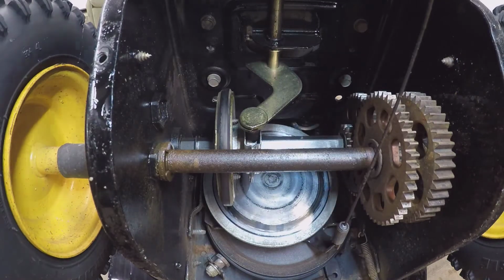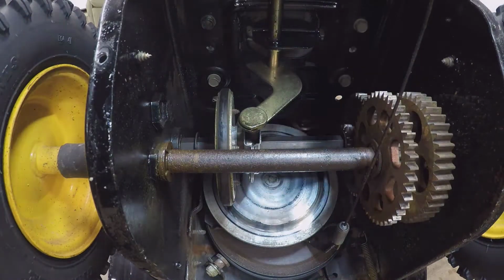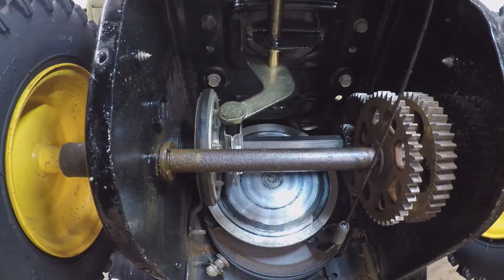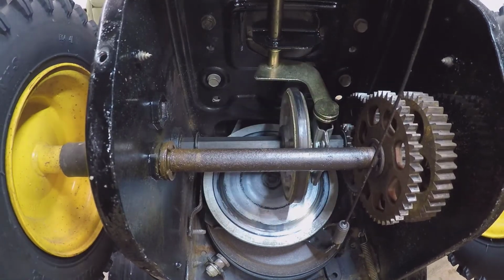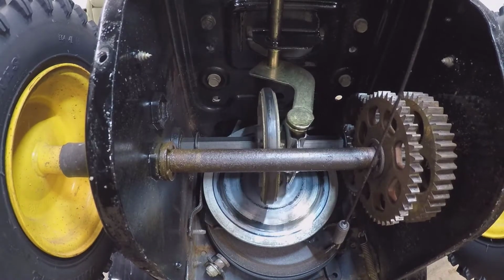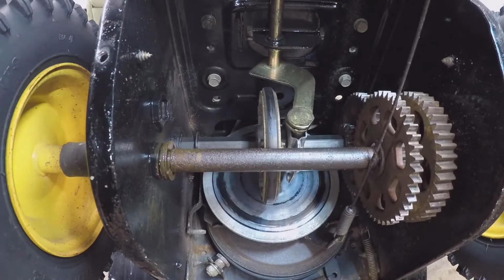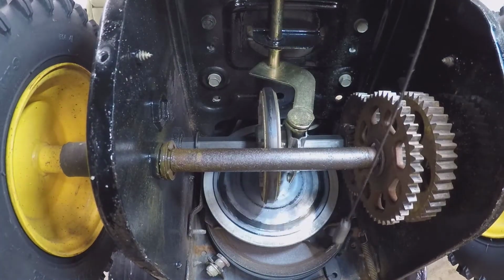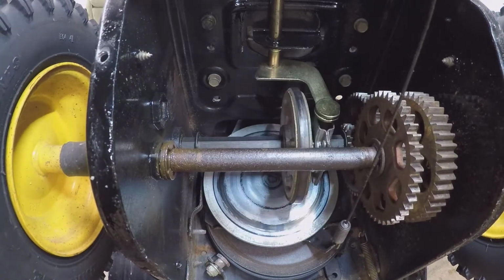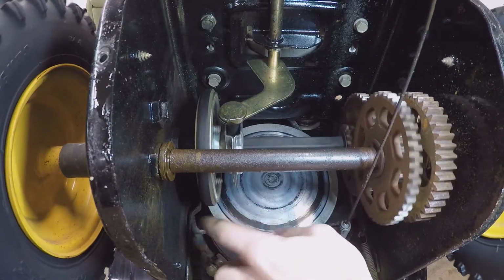And that right here rides on that wheel. It's rubber mounted. So that's going to move and change your gears. Right there, that's going to be full speed. That's going to be reverse. And that's going to be neutral right in the middle. And then once you pull the drive down, it's going to pull that disc up and make contact with that wheel. As you can see right there, just friction mounted. So make sure not to put any grease on that wheel if you're gonna do this.